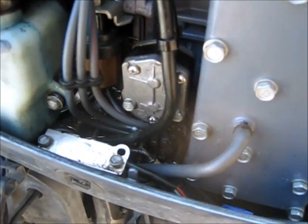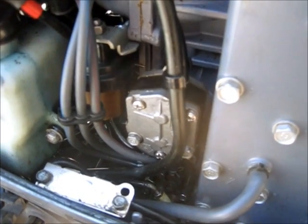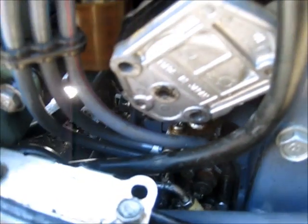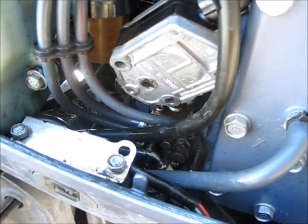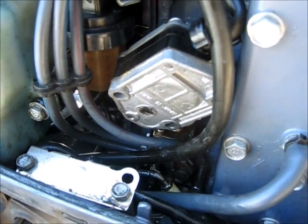This plug is very clean — it's washed out, basically it's getting over-flooded. So your problem with this motor is gonna be your fuel pump. Ten bucks it's leaking gas through the diaphragm and flooding out number three. Here's the backside of the fuel pump — I'm gonna squeeze the primer bulb now and you can see it's leaking gas through the diaphragm. This is why the motor won't rev up past about two grand.